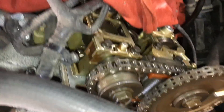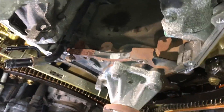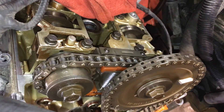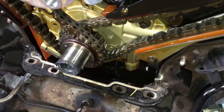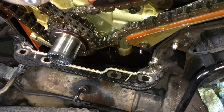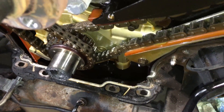If you've never seen a four-valve engine apart, you can see they're kind of similar to the three-valve and two-valve engines, just a little more complicated and heavy-duty. This is pretty much my first time going this deep into one, but it's basically the same thing as the others I've worked on over the years. We're going to have to pull the pan because I'm sure that oil pickup tube is just full of these plastic pieces.